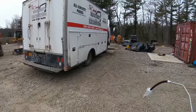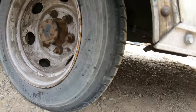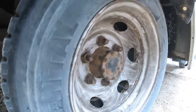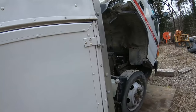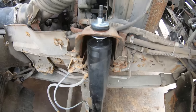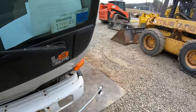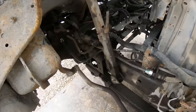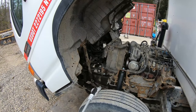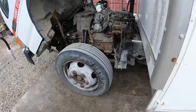To catch up to speed on what I've done to this van: I replaced some rear leaf springs on this side — there were two broken, cracked ones that I noticed when I was greasing everything. Got that replaced, plus two new shocks in the front, and a power steering line right here that had a leak in it. You can see fluid all over the frame rail. Things happen over the winter with the salt — they go, so you've got to replace them as you go.